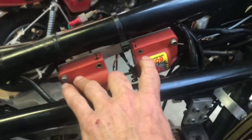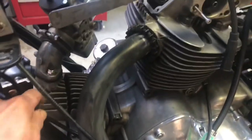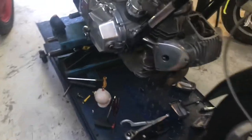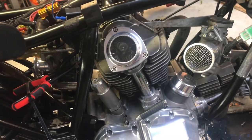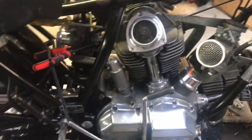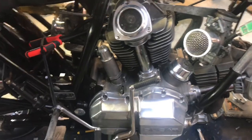I've got new coils and a new ignition system that replaces the original, which just had one step instead of gradual advance. This one is gradual — it starts at 8 degrees before top dead center at zero revs, then goes up to 800 RPM, then past 800 it goes to 12 degrees, and then gradually up to about 23 degrees.